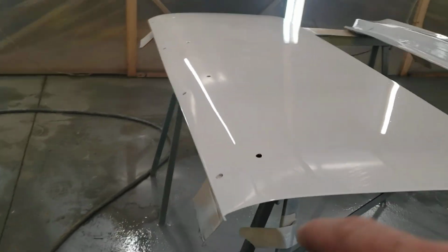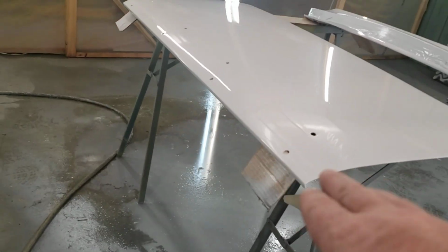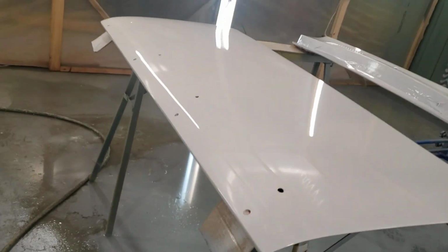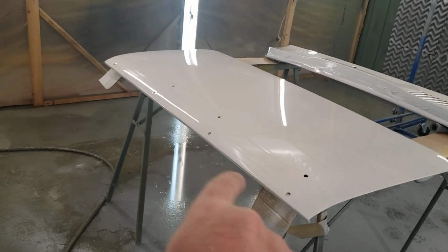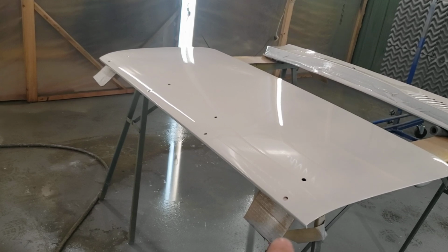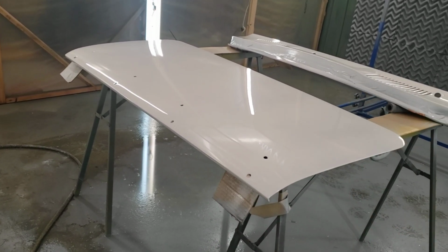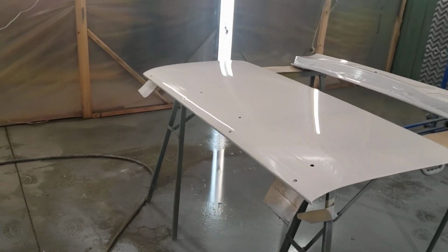For the trunk, I cut the little inch lip. So on the second coat, we didn't go too crazy, so you might see it looks a little dark. You can almost see through it, and that's okay. On our next coat, we'll make sure we get good coverage, because now that it'll turn into like a glue, the next paint will go on it, and it won't want to run unless you put way too much on. So we didn't put too much on there.